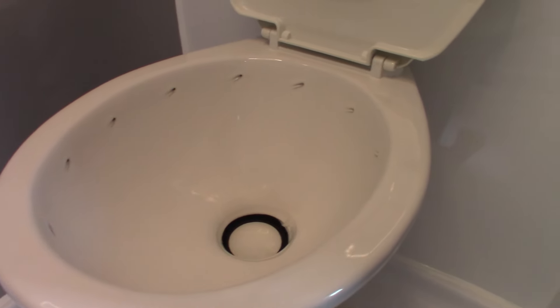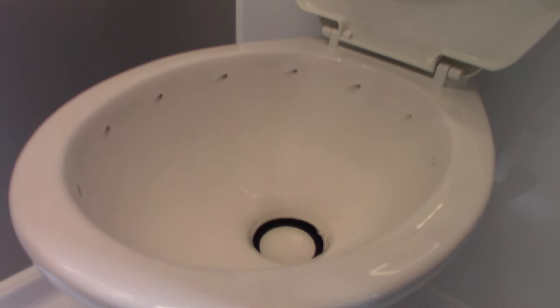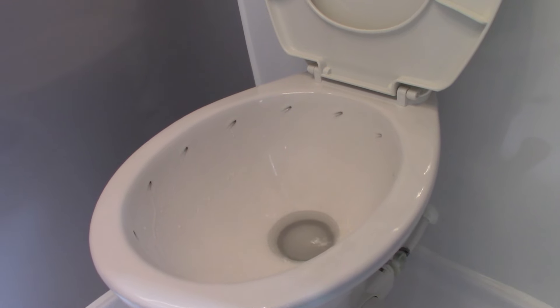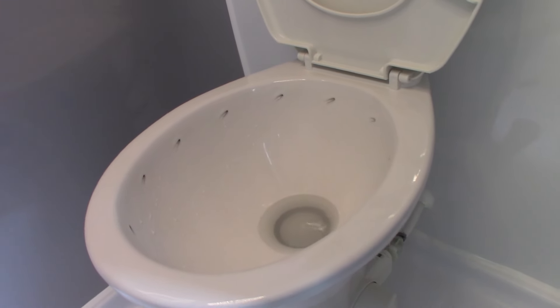This is your European-style shower. You have your shower here and the toilet here. The toilet works like all RV toilets — it's got a flush pedal. You can't use it dry, meaning without chemical and water in it. It sits right over a black tank. When you get set up and hook up your power and water, come over, put a dose of chemical right in the bowl, then stand on the pedal and hold it down long enough to put at least a gallon of water in there. You want at least a gallon of water plus a dose of chemical, otherwise it'll get clogged and smell terrible.